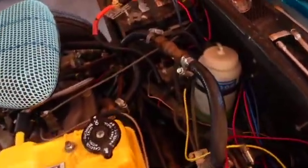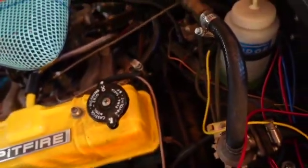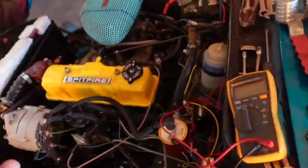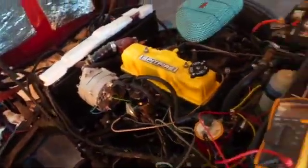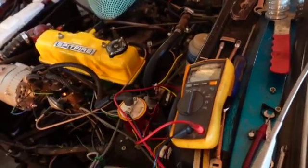So the S-Terminal, of course, is the starter. This one here is the R for resistor, and I'm going to make a little wire and just jump across here, and then we're going to crank her up. This is going to be real short because I don't have a lot of time. I'll show you how this works. We're going to show 10 and a half, 12 volts, or whatever, coming through there.